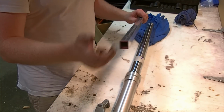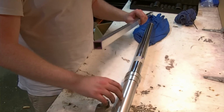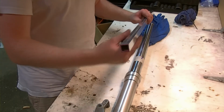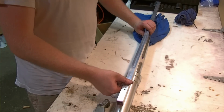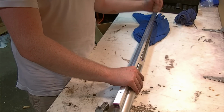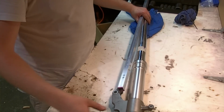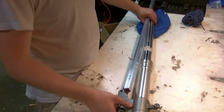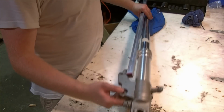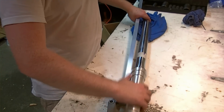You need it to be hollow because the damper rod comes off the body, because it strokes too, it's a piston and rod assembly. Your rod has to be able to go in here and settle, and then this would hold it down into here and lock that into place. And then you put a wrench on this end and you hold this while you crack the bolt loose on the other end, down here at the base. So it gets to be a lot to hold all together and be able to crack loose.